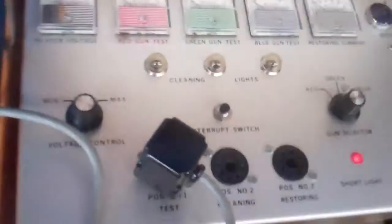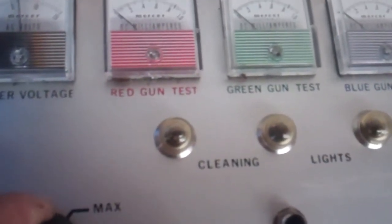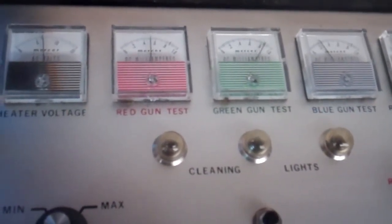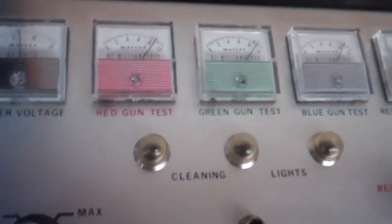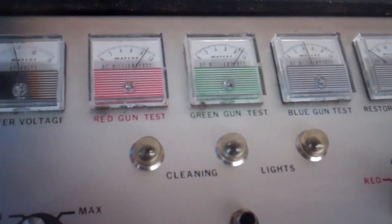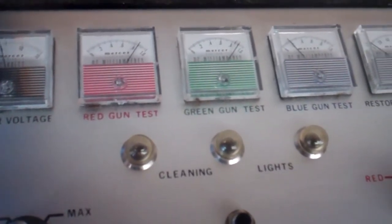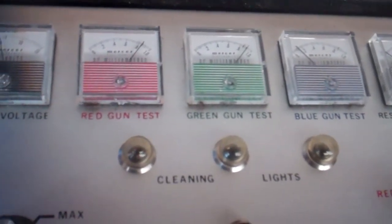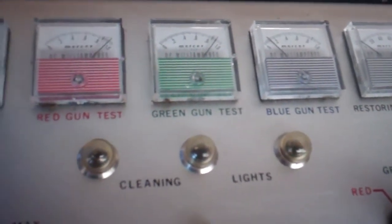Okay, let's check the CRT on this Packard Bell and see if it's as new as it looks. It's pretty healthy. Let's go down to five volts. Blue kind of goes away at five volts, but red and green look tip-top shape. That's kind of bizarre.